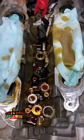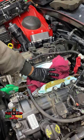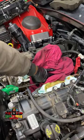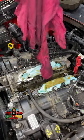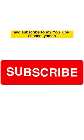One of the reasons I didn't drain it is I don't like playing with the nipples and the drain plugs. I evacuated most of it — this is how I get the last bit: use an old rag or cloth with the blower, just cover it over and use compressed air, and it splashes everything up into the cloth. That's an easy way of drying all of that stuff out — little tips and tricks of the trade. Don't forget to subscribe to my YouTube channel.